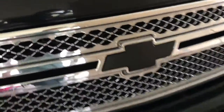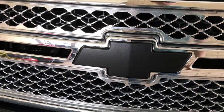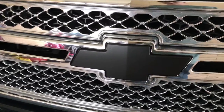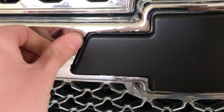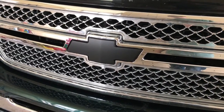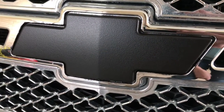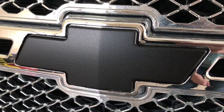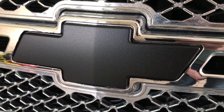Overall I'm pretty impressed. If you decide you don't like it or want to try again, you can just take it and peel it right off. We did a pretty good job of masking off the area so we didn't have any overspray, but if you did have overspray, just take a microfiber cloth and wipe it hard and it'll come right off — see, just with a little wipe it comes right off. Pretty happy with it — first time I've ever done this. If you guys have any questions or know a way to avoid that orange peel look, leave it in the comments. I'm guessing lighter coats and more dry time between them would help — the can said 30 minutes but I only did 15. Either way, thanks for watching guys.